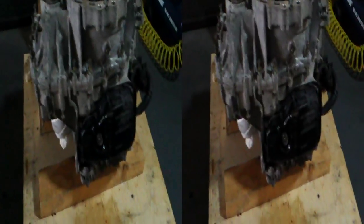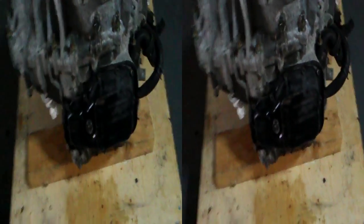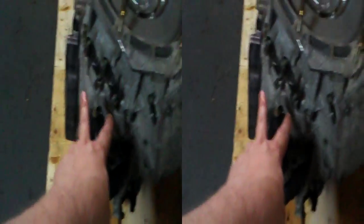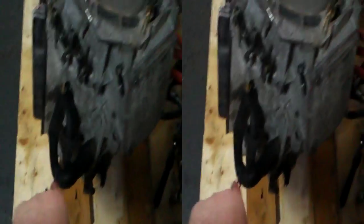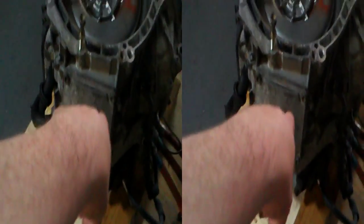Under here, that's an oil drainer, and this one is the coolant. It was quite strange, actually, that I found those out. I've had a little bit of a spill. So those are the coolants — this is for MG1 coolant, that's MG2 coolant, you've got like a joint so it goes through them. This is where the HT and I guess the sensor circuits for the MG1 are.